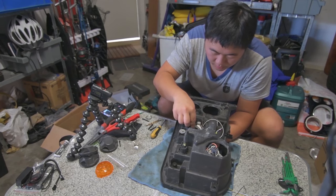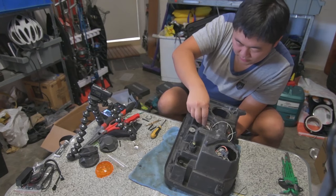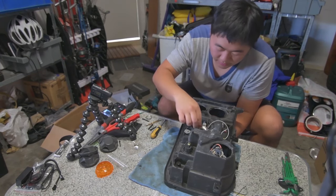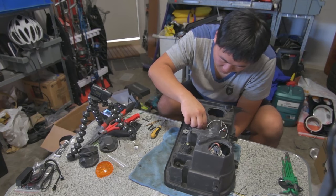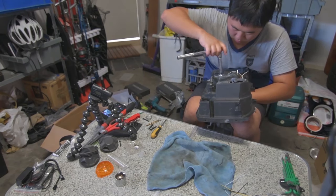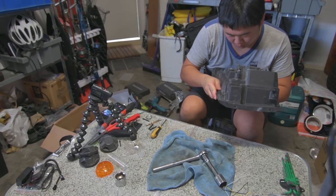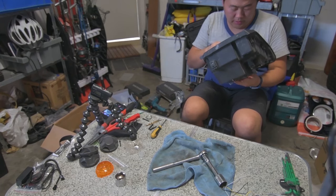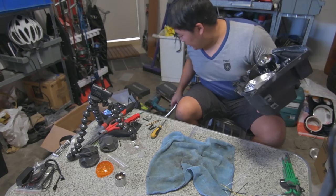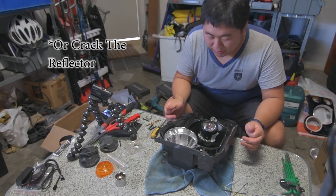Get the H7 ring. It didn't seem to fit the projector for a second there, but I got it. Then you get the securing ring and secure it into place. That was a 27mm socket. Just don't over-tighten it or else you'll strip the threads and you won't be very happy — guaranteed.